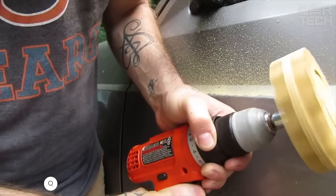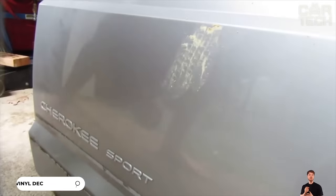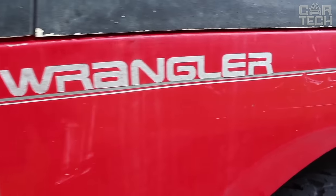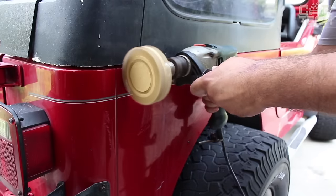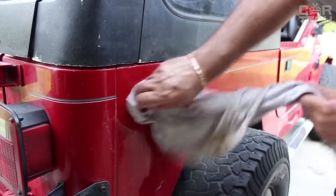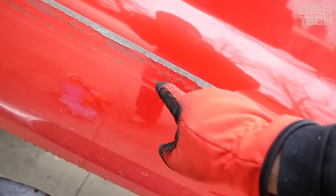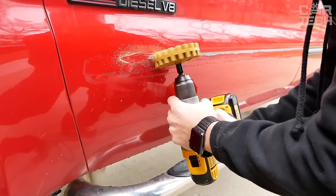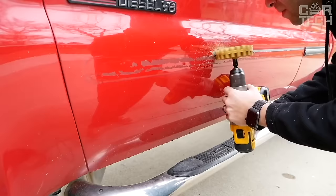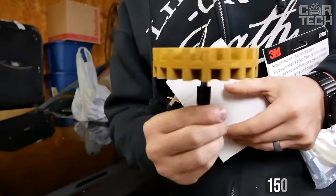Glue or double-sided tape can often leave marks on the car body. After hardening under sunlight, such tape increases its adhesion and is very difficult to remove — most often it remains from moldings, windshields, or stickers. You can try to remove the glue with solvents, but no one will guarantee that the paint on the body will remain intact. It is much safer and more effective to use a special attachment for a drill or screwdriver. A rubber circle with a diameter of 4 inches allows you to gently remove the tape without damaging the paintwork, and it is recommended to work at speeds of 1500 to 3000 RPM.